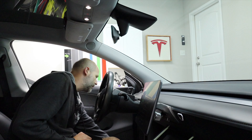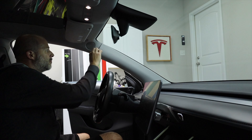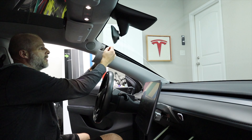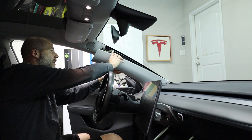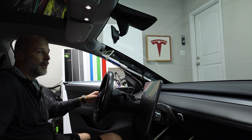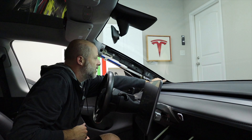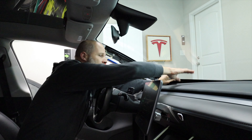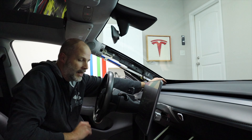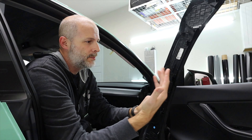So now I'm going to do the other door just like this one, and then we're going to move to these speakers here because it takes a little bit of finagling to get to those speakers. What we want to do is pull this tab off, which is right down here. Then we want to get our hand up in here and just unclip this. When you do that, you wiggle — there's another little clip up here that we want to pull off. You don't have to pull it off, but it makes your life easier. Then you can wiggle this out. There's nothing in this at all, but there is an airbag there — you want to be careful of that.